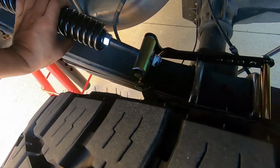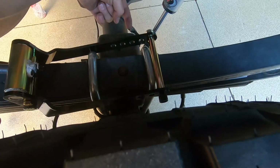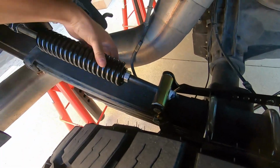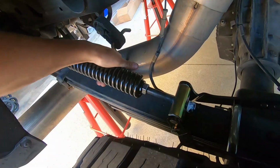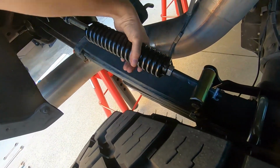Now what I did do, these are set up the exact same, is I decided to take that bolt, because I got to take this out to put it on, and put it in the other way. So you do want to put the Allen on that side. You don't have a choice anyways, because your brake caliper's over here and you'd never get it on unless you took all that off, right? So I'm going to go ahead and keep going.